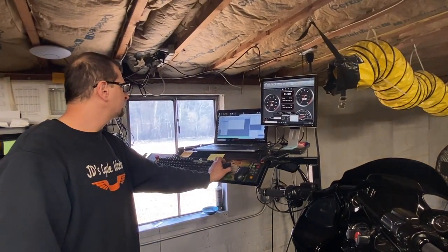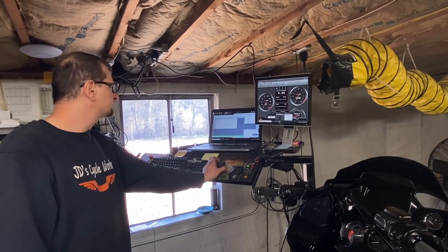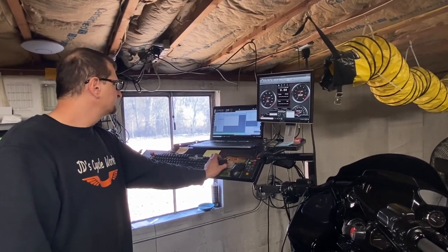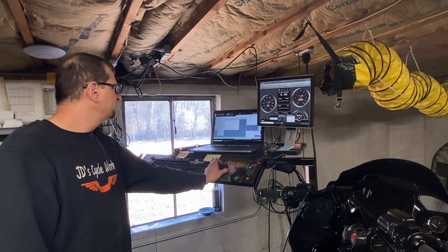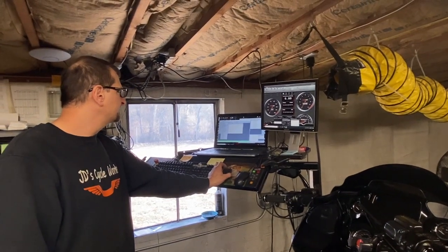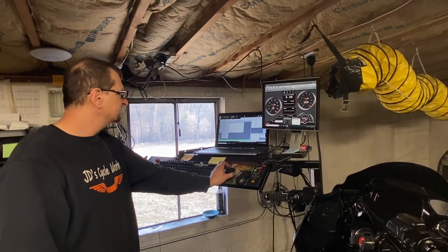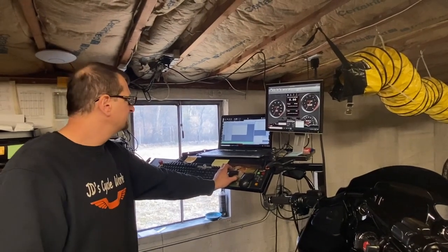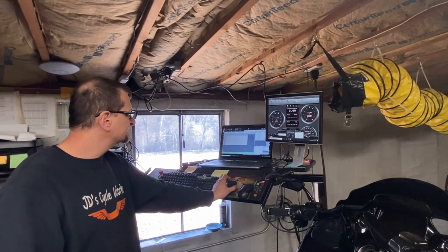And we have tables for timing. Each cylinder has its own timing table. And there's a lot of other tables which help me do other things with timing and knock and lots of other settings on it. So it's interesting. These are ones I have to choose from. All these parameters, and I work with most of them when I'm recalibrating a bike to make it run the best. And I make the bikes run efficiently where they need to be run efficiently, down here in the light.